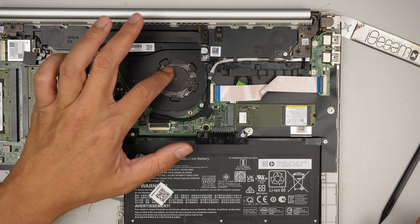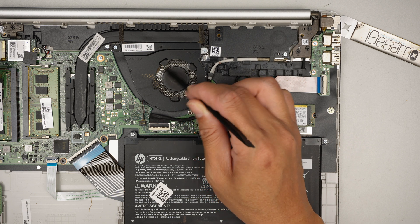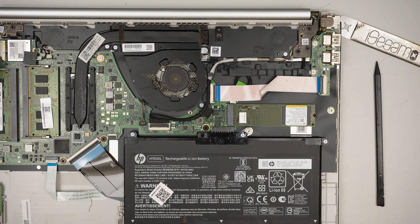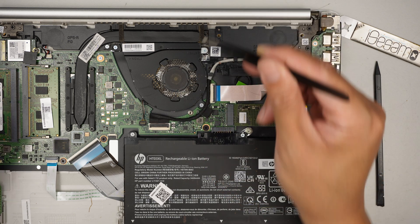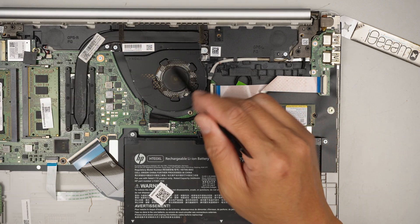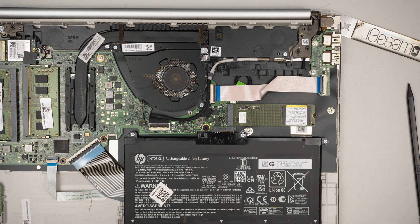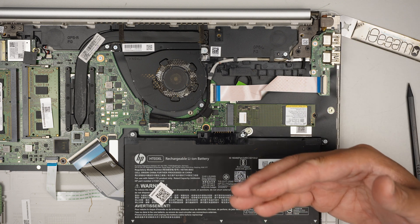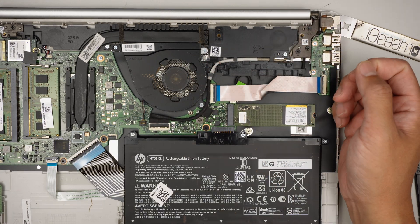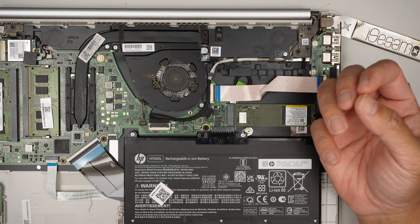Now there is the CPU fan. As you can see the CPU fan is stuck — I'm trying to spin it but it's not spinning. Looks like there was something here... I found it. There was a broken piece of plastic right here that got stuck and prevented the fan from spinning. So that was the plastic. Does it spin now? Yes, it spins much better. I was lucky enough that something got stuck and prevented the blade from spinning.